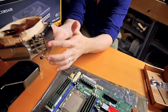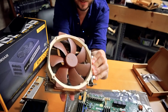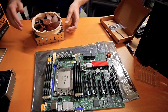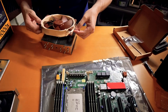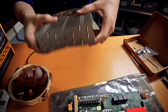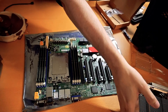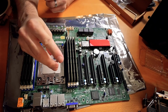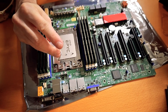These two mounting points are the wider spacing and these two are the narrower spacing, so it actually needs to be installed this way, but we're going to relocate the fan over to this side. We'll go ahead and attach the heat sink first, but before that we're going to apply thermal paste. They included some paste, but I'm going to use the MX-4 that I've got here, applying the first pattern of dots.